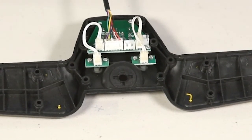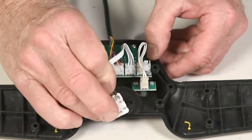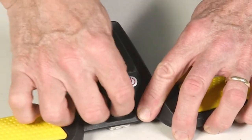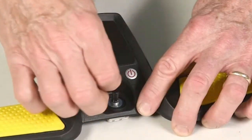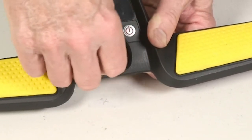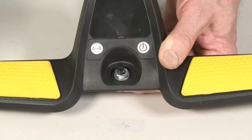Once you've taken out the old defective rheostat, to replace it with a new one, you reverse the process. Step one: attach the wires with the connector into the housing on the circuit board. Then take the rheostat stem and push it through the frame, turn it over, and apply your three items: a rubber washer, a metal washer, and then the jam nut or wafer nut, which gets screwed into place to secure the stem onto the handle frame. You may need pliers to tighten it the last few turns. Then reapply the knob.